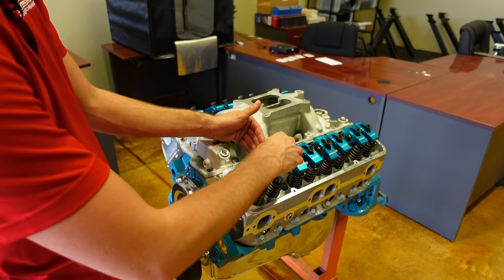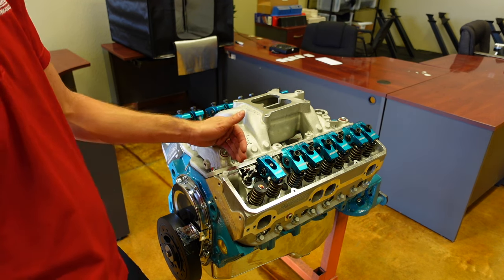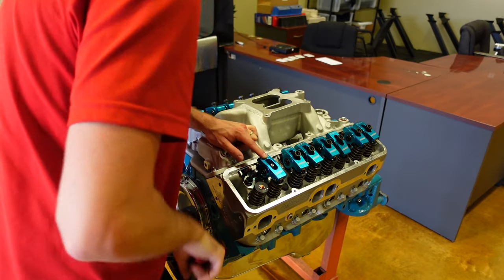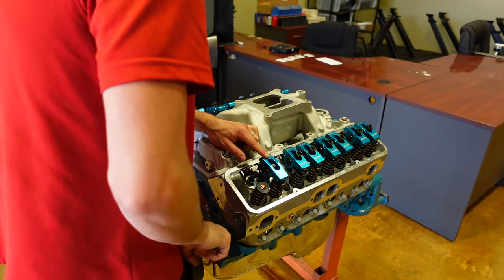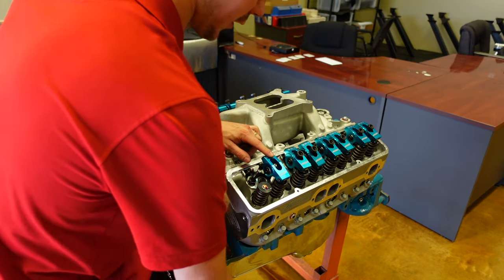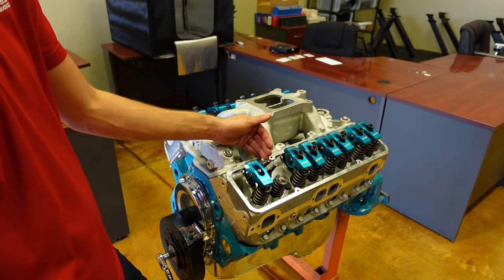We're actually going to go to the intake valve. There's a rule of thumb I like to use called the ICE method — when the Intake starts to Close, set your Exhaust. We're working on the exhaust valve first, so I'm going to roll this engine over until my intake valve starts to close. Put a finger on top of it and start rocking the motor. I'm going to roll it over until I feel it start to rise — meaning we're lifting. My intake is rising, there's peak lift, I felt it stop rising, and now it's starting to close. Now that the intake is closing, the exhaust has to be on the base circle of its camshaft. This works for camshafts that are stock, small, or huge. When the intake is closing, set your exhaust.